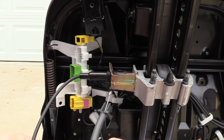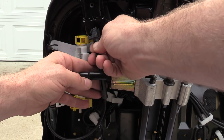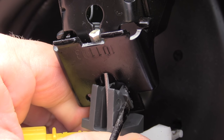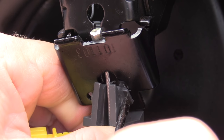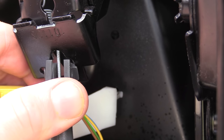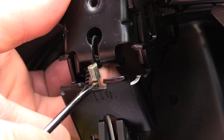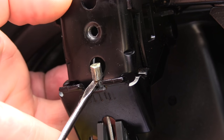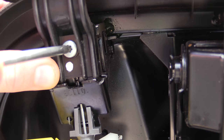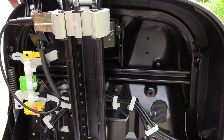Next, we're going to route the cable. Notice that it has to loop around this way in order to not hit any of the connectors. Then we need to snap the plastic retaining tabs into the seat — this can be a little bit tricky, as they're pretty tight, so you might need a screwdriver or a pair of pliers to lock the tabs in. Just be really careful because you don't want to break your brand new cable. Slide the end piece of the cable up and through so that it sits in the bracket where the handle attaches, then go ahead and put the handle back on.